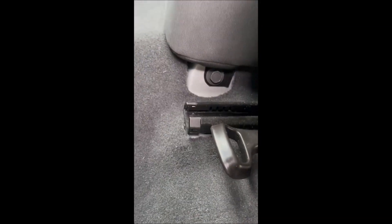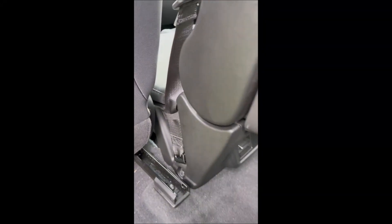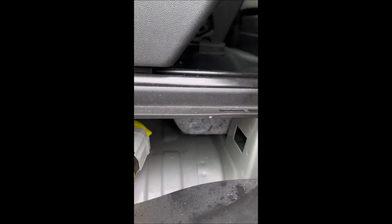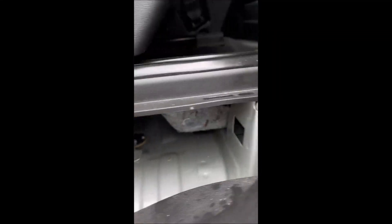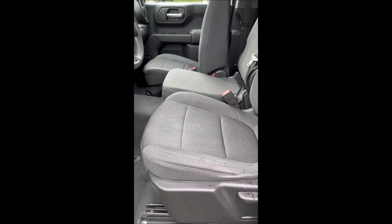The driver's seat is going to get bolted back in. You'll notice there are alignment pins in the front and rear, so just make sure those holes line up, put some Loctite back on those bolts, and you're good to go. Those two fasteners are back in, the console's in, the bezel's back on, and it's just time to button it up and reconnect the battery. One more thing — you need to re-clip the bulkhead connector; there's a plastic socket for that metal tab, so just line it up and snap it in. Then slide the seat back and we're set.